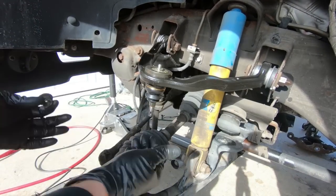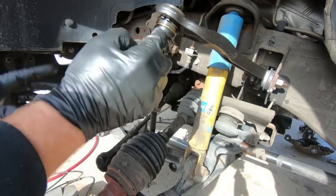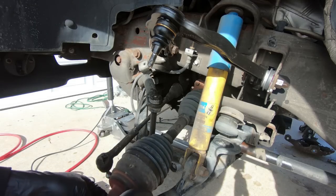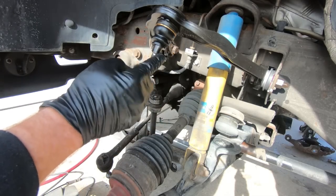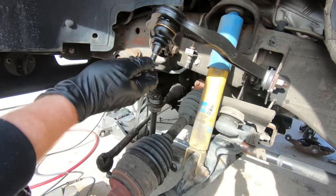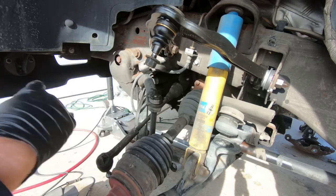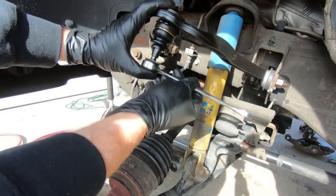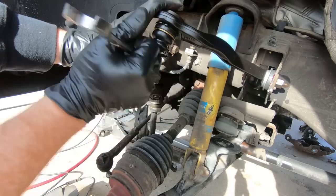So before we put the spindle on, we do have to make a trim, and that is on this guy here. The reason being is because it sticks down too far, it's actually gonna hit. Now, if you're not working on a 4-wheel drive, this isn't gonna matter, but these guys come with a new bolt, and it's a little bit shorter than this. So what I do is I thread this on, and that's basically showing my cutting point. The instructions say 3/8 of an inch to 1/2 an inch. And so this ran all the way up, is right in between those two numbers.